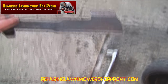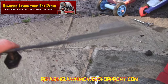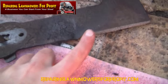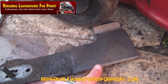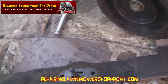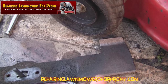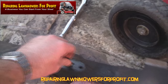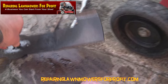So I've got this blade and I'm just going to run it along with the grinder in the garage. I don't do blade sharpening videos because people can obviously get damaged. But I'll just run the grinder straight across this to take any massive nicks out. If you can see the angle of this blade — all you've really got to do with the grinder, or you can do it with a file, is just follow that angle. You want it somewhere near because the angle is set to give it enough uplift to push cut grass through the back of the mower into the grass box. Try to follow the original angle if it's good, take any big nicks out, just go across twice. Then use a blade balancer to make sure it's centered so there's no vibration when you put it back on.